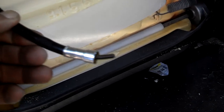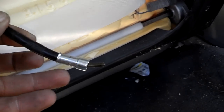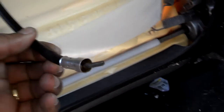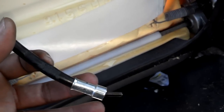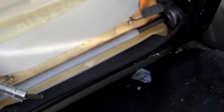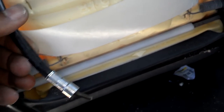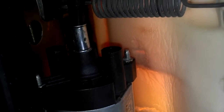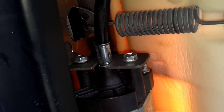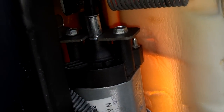To repeat: you heat up the metal sleeve until it's hot, grab it with needle nose pliers while heating it, then slide it over the plastic cable until it comes down to the bump in the cable so it's all the way secure. Now I've got that much cable sticking out, so I'm going to thread that into the motor and secure it back in place with the bracket. With the cable back in the transmission, I'll put the bracket on. Once both bolts are tightened all the way down and the cable is secure inside the transmission, go ahead and test it to make sure it works.